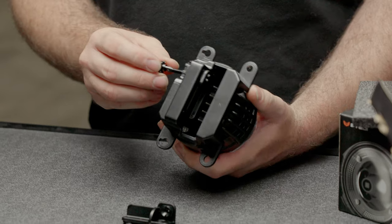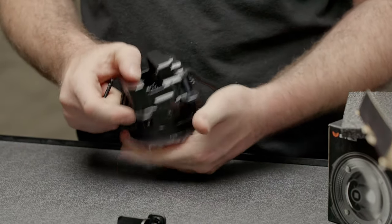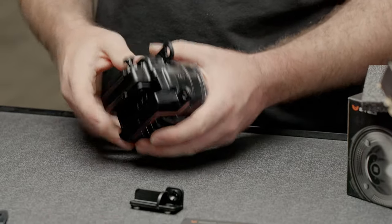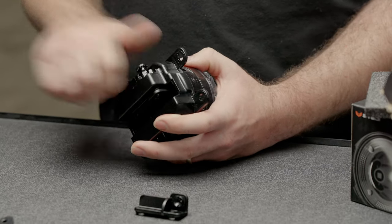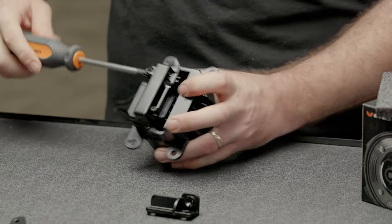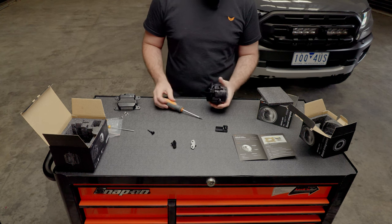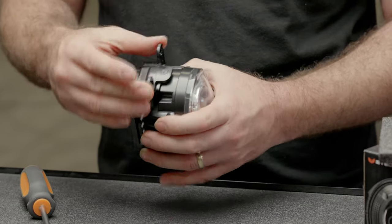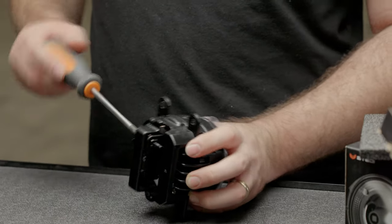Your adjustment screw goes through the hole — you'll see the female side that you clicked in earlier will be lined up with that. If it's not lined up, you've done something wrong, namely with these pivot lugs. Get that started with a Phillips head screwdriver. Once you have it, aim the driving lights parallel with the front face — line up these two bolts at least with this bolting face with the front.